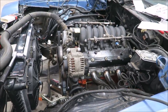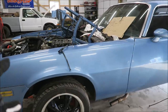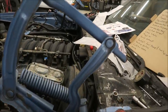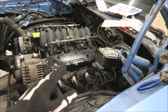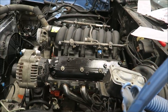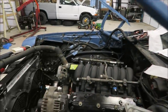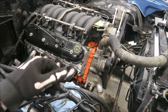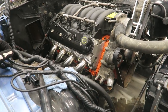I forgot the water pump gasket so we can't do that yet. I think I'm gonna have to cut the front springs because there's not going to be a ton more weight on the front end and there's still a big gap there — that'll be one of the last things. I'm not going to put the spark plugs in yet because I still have to do the converter bolts, so I'll roll the engine over without the plugs. I could start plugging in wiring, running fuel lines, and put the oil filter and oil in so it's not sitting completely dry and we can check for leaks.